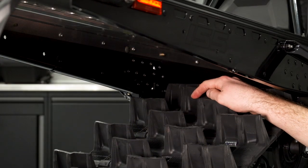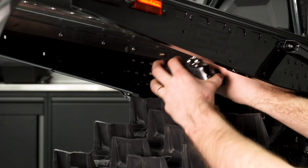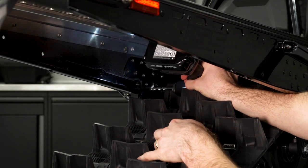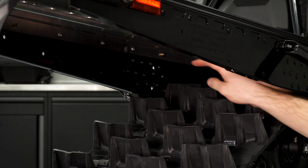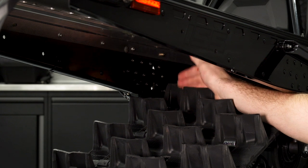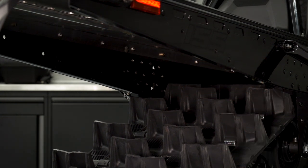With the pilot hole drilled, I'll bring my quarter-inch bit through the back side and finish drilling out that hole. It's important to note that when drilling these holes, you want to make sure that there are no track lugs in front of those holes. If needed, you can rotate the track slightly to get the lug out of the way.